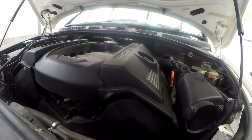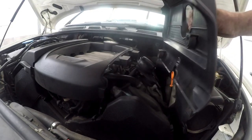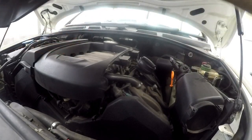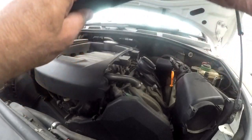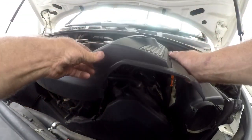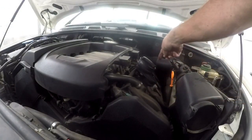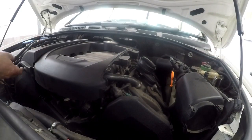I'm just going to do the oil change, but I want to show you — if you're going to be working on the engine, like to take the spark plugs out, there are three covers here. Starting on this side, this cover just basically pulls up — it has grommets, little indents with rubber grommets, which basically hold it. It just clips onto the engine — two on the engine and three on the center cover. You have exactly the same thing on the other side, so all you have to do is just pull them off.